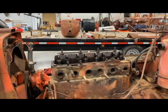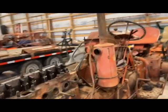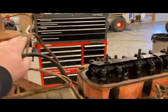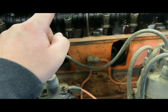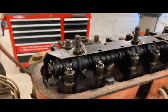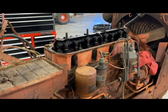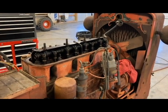We've been working the last few minutes getting the rest of the head stripped down. We got the bar that runs up on top between the radiator and where the fuel tank would be — got that removed and sitting aside. We've got our wire harness pushed down out of the way. The next step is a couple of oil lines to disconnect from the head, then I've got to get the shield off, one more oil line, and then four bolts on top to get loose. That will allow me to get the rockers off, pull the push rods out, find lift points, and continue taking the head bolts out.